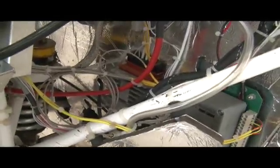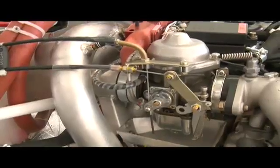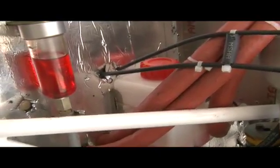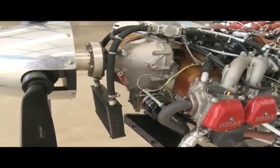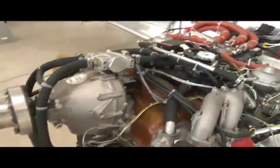The plug is currently up, but the plug must actually face downwards so that if there is any moisture that does come into the engine compartment, it doesn't sit inside the rectifier regulator. That's the position of the TCU, right there. And here is the routing of the choke cable and the throttle cable — you can see the positions of everything that goes on here.